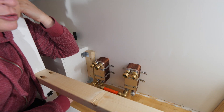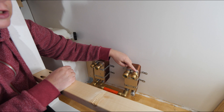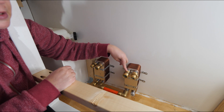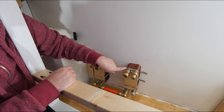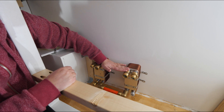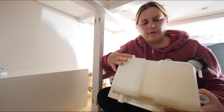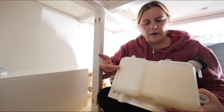Just in case you're interested in the fitting sizes: all of the ports on the exchangers are three-quarter inch. The coolant side goes from a three-quarter inch female NPT connector to the PEX tubing — the fluid runs down, across, and back up. All fittings on that side are three-quarter inch. We're using half-inch fittings on the water side, transitioning from three-quarter to half-inch. Now that the exchangers are on the wall, we're working on the tank — this is where the reserve glycol will be held.